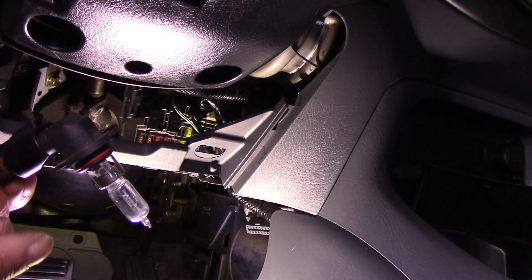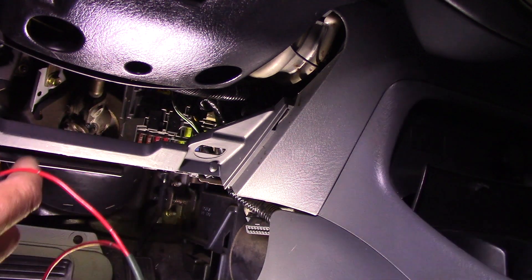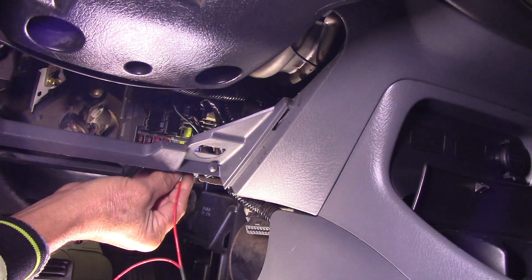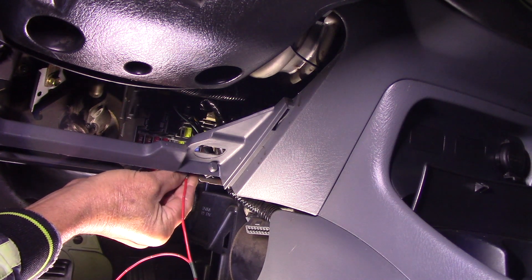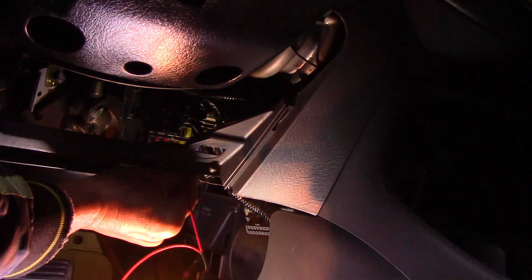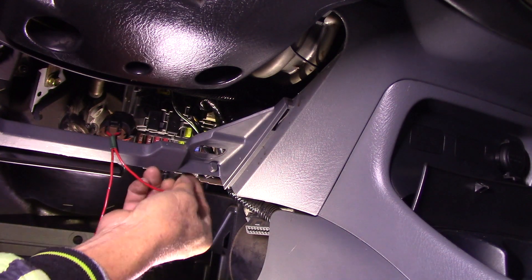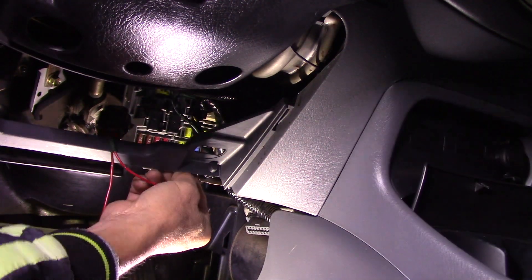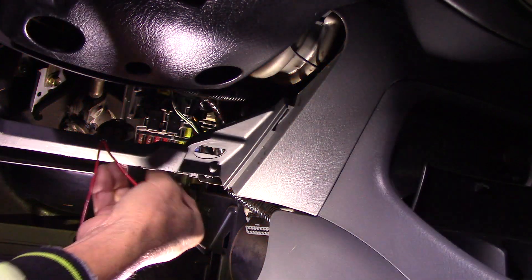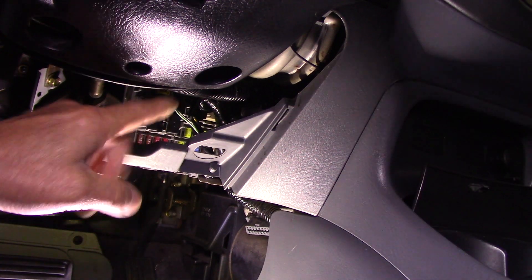Every time I check for a short circuit to ground, I use the vehicle headlight like this - if it's short, the headlight will light up bright. As you can see, I can touch one side of the fuse, another side nothing. As you can see, this headlight is very bright. Confirm, guys. So now we know exactly the fuse blew caused by a direct short to ground.